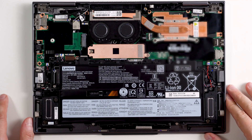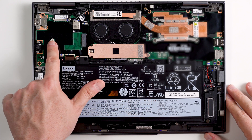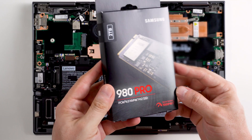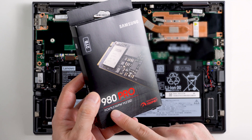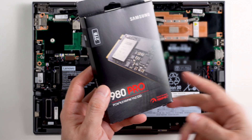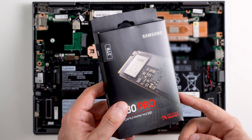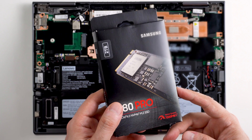Here we are. As I mentioned earlier, there are no RAM expansion slots as the RAM is soldered onto the motherboard. However, we can upgrade the hard drive, and I also see a second slot here which in theory should allow us to add a secondary drive. I'm going to be using my favorite drive at the moment — the Samsung 980 Pro. This laptop supports PCIe Gen 4, and this drive can do up to 7,000 megabytes, or 7 gigabytes per second throughput. This is a 2 TB drive, and as I've mentioned in previous videos, it's much cheaper to buy the laptop and do this upgrade on your own.